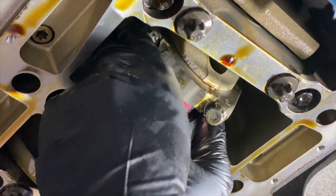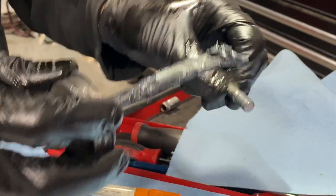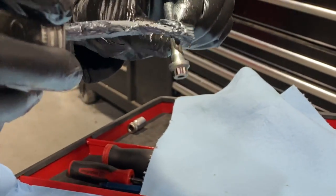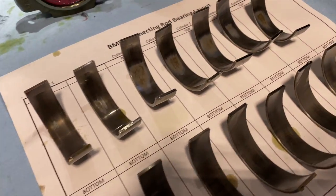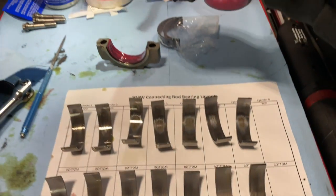That's not to say it's impossible to detect a failure through oil analysis. A friend of mine recently saved his S65 E92 M3 after an oil analysis showed a massive spike in lead — it triggered an immediate replacement of the bearings and the car is fine. The moral of the story is oil analysis is not a fail-safe, but it is a good tool to detect something that might be impending doom.